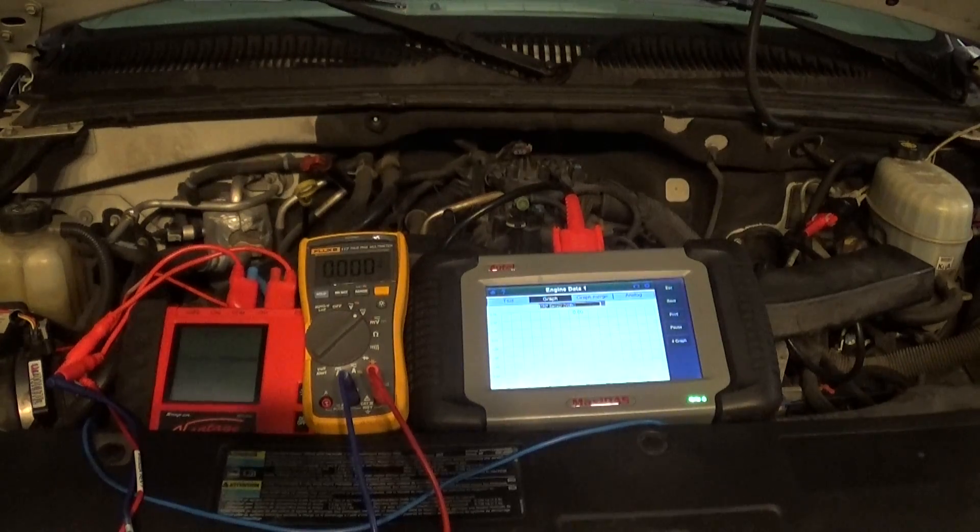So basically we want to check our signal wire. After we check the ground and the 5-volt reference, we need to make sure that our signal wire is not shorted to ground and that it's not open. This would be the case when we unplug the sensor and our voltage goes down to zero. In some cars, as we unplug the sensor, the voltage will go up to like 4.8 volts — that's a bias voltage — and we would know that our signal wire is okay.